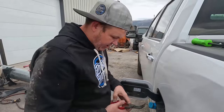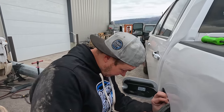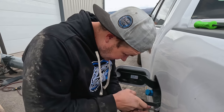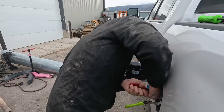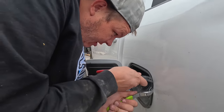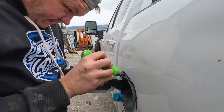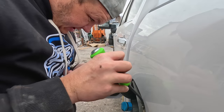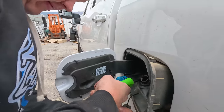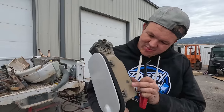On these newer fuel pockets it's all plastic and clips. I have to change this bedside, so I'm not super concerned about hurting it, but I do have to get my tool up under the seal and work it out — it's got four clips that have to be depressed. Kind of a weird design. Once you can get under it, you can get it moved out. I'm using bars to keep outward pressure. Got it — now I just got to work the rubber out and it'll come off. I didn't even break it.